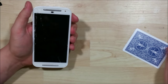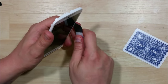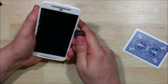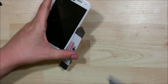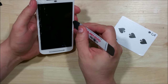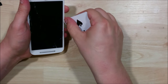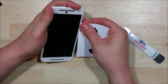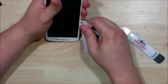If you do use one of these, you want to be fairly careful not to damage the plastic frame. Put the tip in pretty deep, maybe try to put the flat side down and pull back to get a larger surface area started and start to pull the screen back — that will help you not damage the plastic frame. Then maybe we can stick our playing card in. There we go, got it started, so we're just going to move this up. Once you get started it gets a little bit easier.